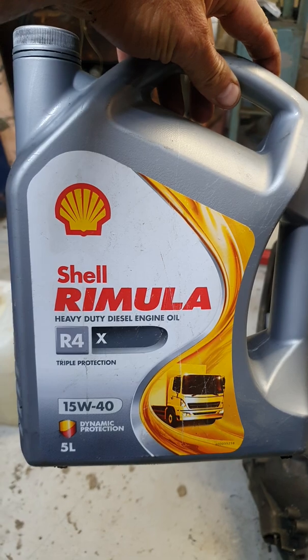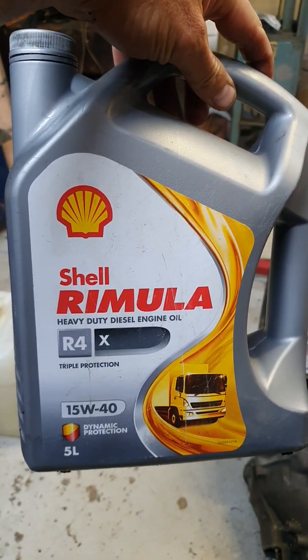There's the oil running at the moment. It seems to be working, but in the long run, I'm going to go with Liquid Moly or Fuchs Motor. Fuchs is really a good oil. When I built motorbike engines, that was the go-to oil. Just full synthetic. You have to change the intervals a little bit, 5 or 6,000 kilometers, but at the end of the day, still magic oil. So the next part on this will be part 3. We go to the logs and just show you what that looks like.